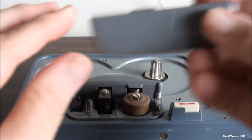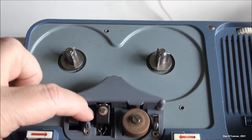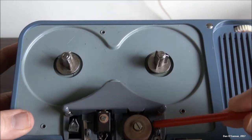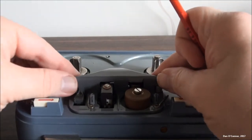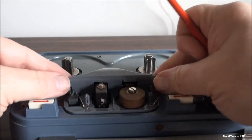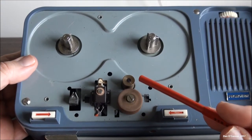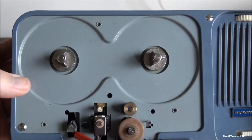Take off the front tape guide head. And if you want to take off the back tape guide head you can — push these two little things out. Now we can take the back of the tape guide off. Now we can see better. So you have your pinch roller and your capstan, your tape head, your little brush, and your magnetic erase head.